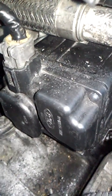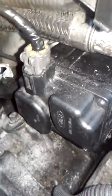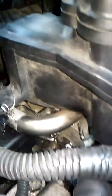So I replaced the bushings. As you can see, they look brand new. The white ones there, as you can see, there's four of them. Two at the unit itself, at the intake manifold runner control valve, which is the name of this unit right there. And there's two of them for the other little butterflies that are attached to the manifold head on top. One of which you can hardly see because they're really down there. As you can see, one of the bushings, the white ones, that's a butterfly over there. One of the butterflies, and this is another butterfly attached to the engine.